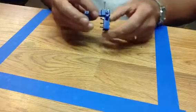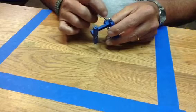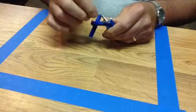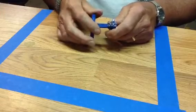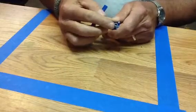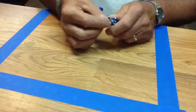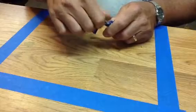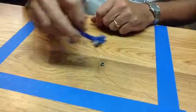Thread it down in. Inside of here, you won't see it, but there's a nut, and it's captured by this rectangular plate. You thread it down in, and then you put a jam nut on the top so this does not come out. This is going to be stationary. You also want to save the nylock nut. This is what's going to hold your plate on afterwards, and the nylock is just simply the best thing to use instead of a lock washer and flat washers. Save that. Then we'll put this aside.